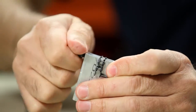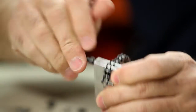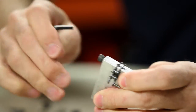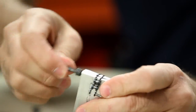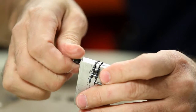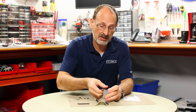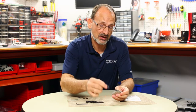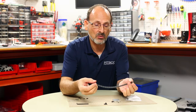If I've got it in place properly, I should be able to put that bolt down almost finger tight. There it is — back that off, and you can see the chain came apart. So once I have my chain at the right length, I can see I have two links that match up on the interior.